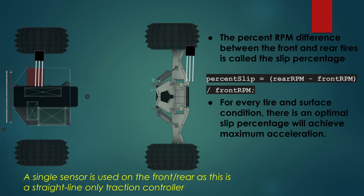In this case we're looking at how fast the front wheel is spinning in relation to the rear wheel. If the rear wheel is spinning faster than the front wheel, then the Arduino calculates the percentage difference. If that percentage exceeds a configurable threshold, then the Arduino reduces the throttle. A common misconception is that traction control aims to eliminate all wheel spin, but in reality, due to the elasticity of rubber and differing surface conditions, there is some value greater than zero of slippage that results in maximum acceleration — typically between five and ten percent on pavement.